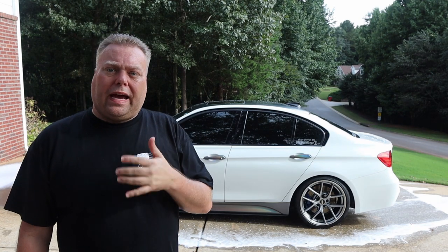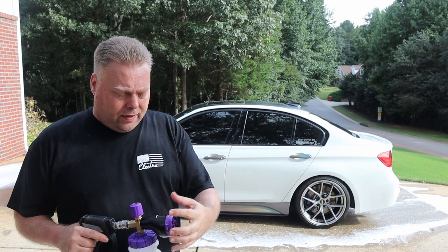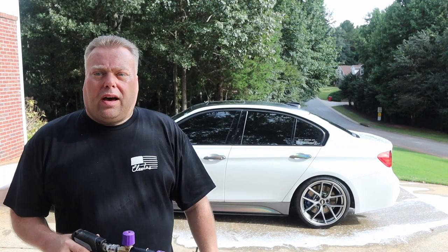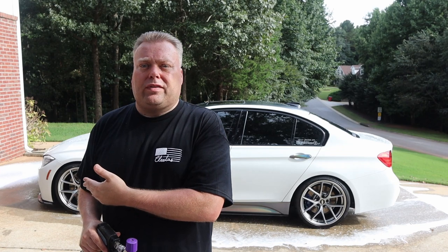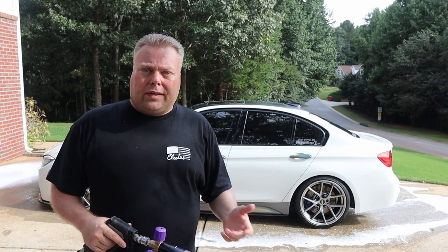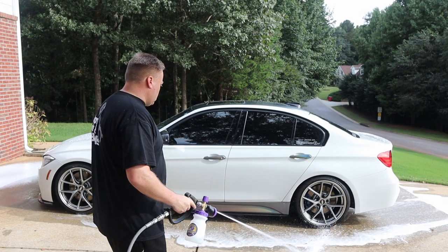Well, so much for the 1.25 with the active. It is overloading the amperage because it's just dialing back, I think, too much of the flow. It's restricting it too much with this head right here. It's pushing between 15.3 and 16.2 amps. I have a 20 amp circuit, so it's not that big of a deal, but it's an 1800 watt motor, that's 15 amps. You don't want to overload it. I'm going to do a little bit just so you can see.